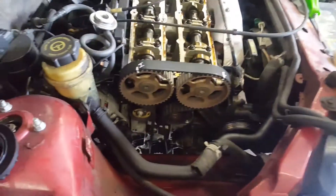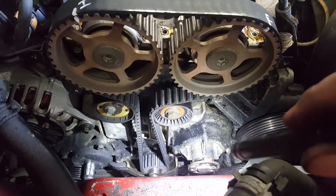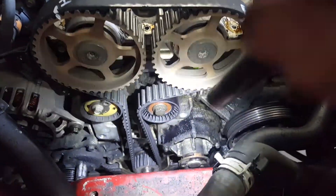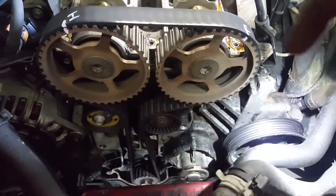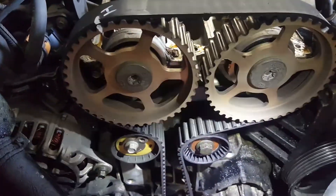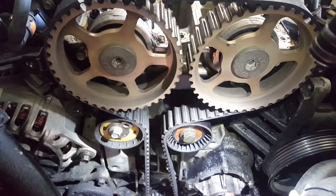Let me get my flashlight out here. This is the version with the water pump that is not driven by the timing belt — I believe some of these are, but this one's not. The water pump is right there, timing belt still intact for now. Coolant was coming out of this area, and I've determined it is not the water pump. I hooked a smoke machine up to the coolant system because it's empty — it's a pretty massive leak. The coolant is actually coming from behind this rear timing cover, behind all this timing stuff here.